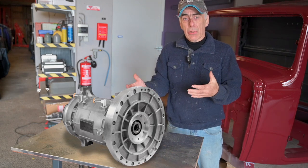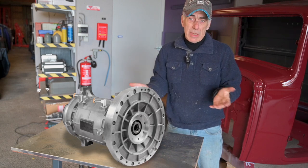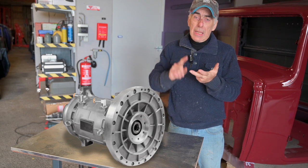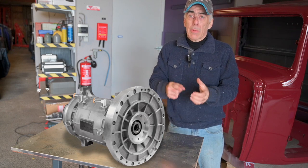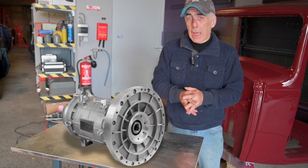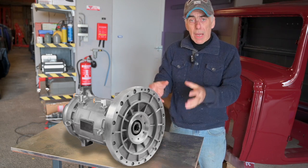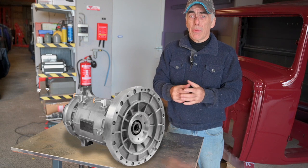Both have advantages and disadvantages. The old gasoline engine is an issue for emission control nowadays where I live - you're banned from cities and so on. It requires a total engine overhaul, a starter motor, alternator or dynamo, carburetor, radiator, water pump - all these things need to be fixed. That's a lot of work and I'd still end up with only 35 horsepower from this small engine. I'd also have to recondition the full gearbox and get a new clutch.